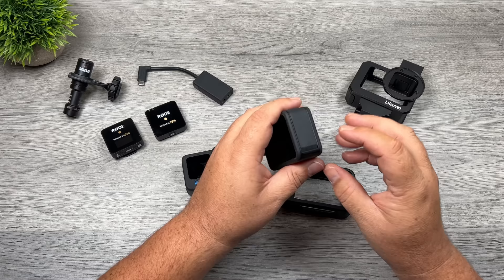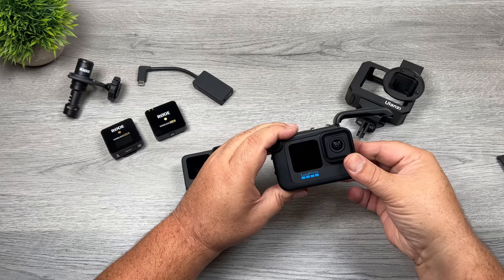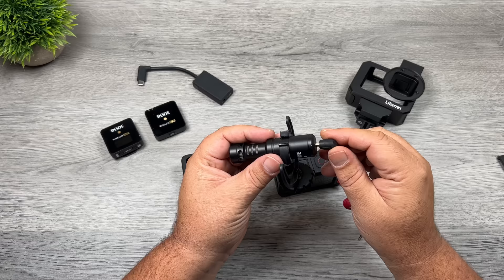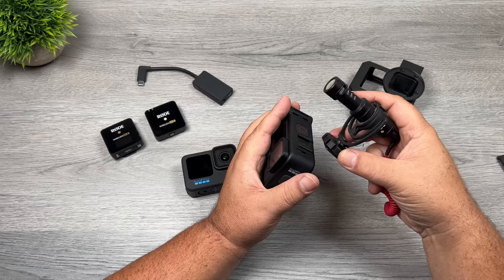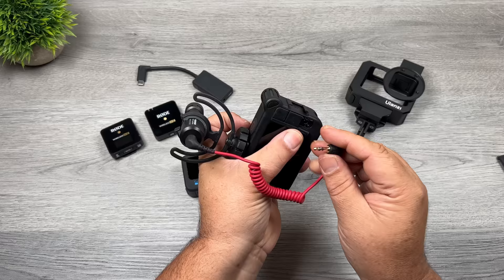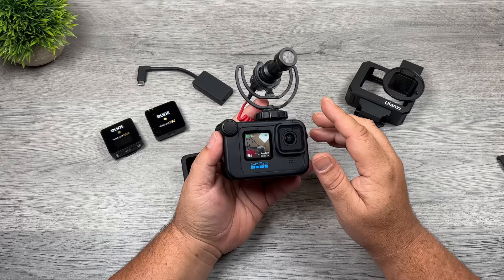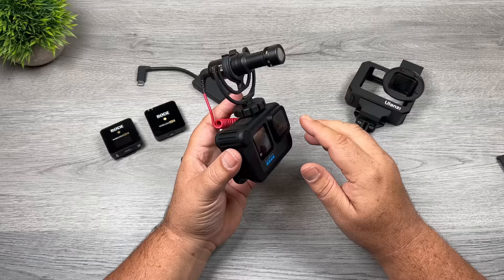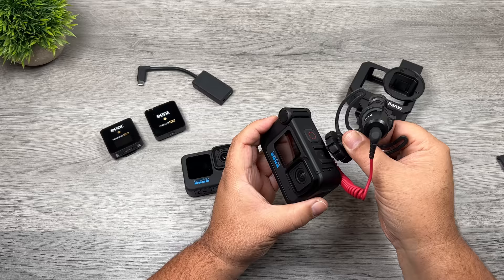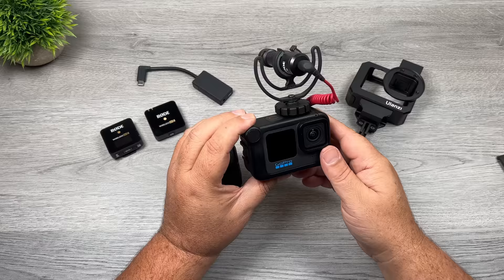To use the Media Mod, we first remove the door of the GoPro — it's designed to come right off. Then open up the Media Mod and slide the GoPro in, making sure it's connected properly. Take your microphone and pick whichever cold shoe works best for you. Watch out when attaching a shotgun style microphone — if it's too long it could end up in the field of view of your camera. Take the other end of the TRS cable and plug it into the back of the Media Mod, and that's it. When you power on your GoPro it's going to know right away that it's installed in the Media Mod and that there is a third-party microphone attached, so it will disable the built-in microphone. There's nothing you have to go in and change in the settings — just plug in your microphone and it'll be ready to use. You can flip the microphone around to whatever works best, whether you're doing commentary or vlogging using the front selfie screen.